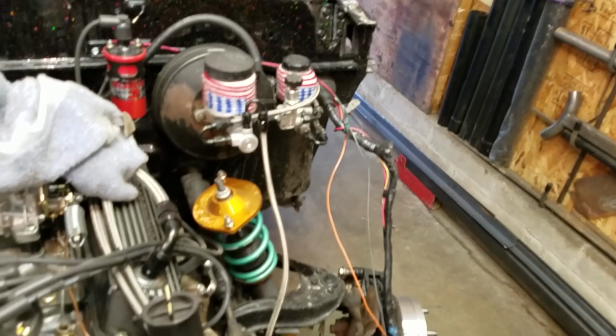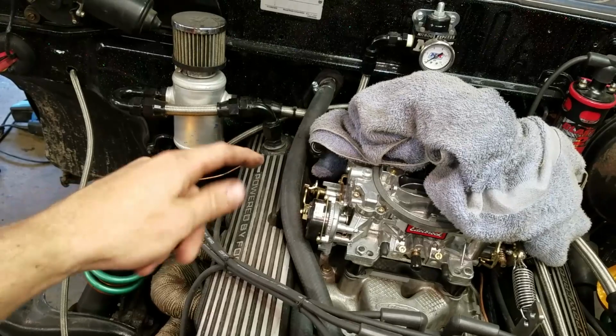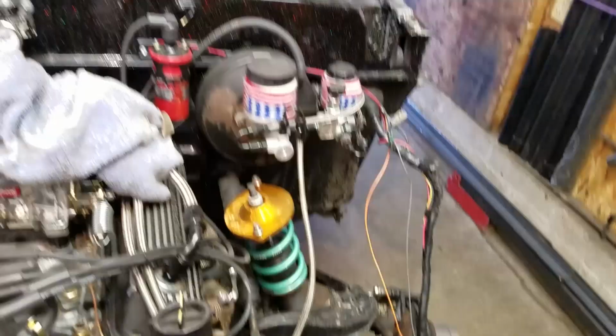Like, I'm going to get valve covers, ones that are just flat. You can see my JB weld broke here. Don't have anything on them, just plain aluminum, no breathers or anything. And then I'll drill holes and get like a male AN fitting, and then put a nut on the underside so it's not super jank like that is. And I'll paint the brake booster and those little spacers there.